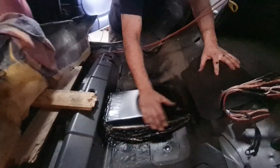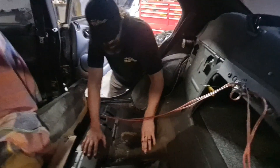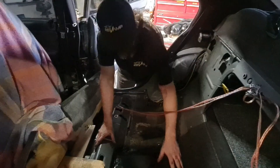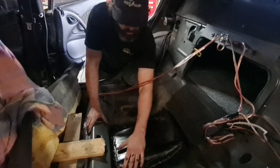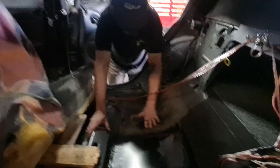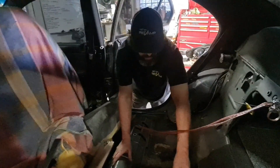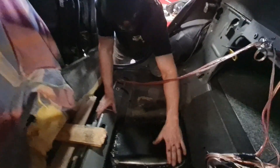This is the hump under the seat from the inside — it doesn't look like a lot from underneath but from in here it is quite sizable. We didn't want to interfere with the seat mounts and didn't want to get any closer to the seat belt mounts because of safety. We've put seam sealer on it, painted it, and we're going to redo all the sound deadening, adding extra around here and through here because exhaust will be running fairly close to the floor. That should help protect rear passengers from heat, noise, and stop any vibrations through the body.